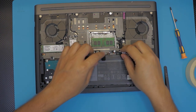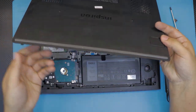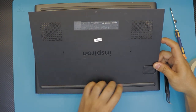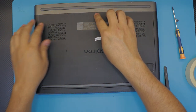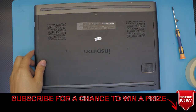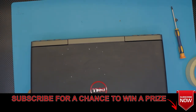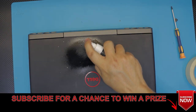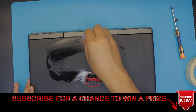We're almost done — last thing is to put the cable for the battery. Make sure you put the front end of the laptop down first when placing the bottom cover, slide it underneath, then push down the sides, and last put the top screw. Alright guys, I hope you really liked this video — if you did please click the thumbs up button. Subscribing really helps motivate me to make more videos. Thanks for watching and I'll see you on my next video.